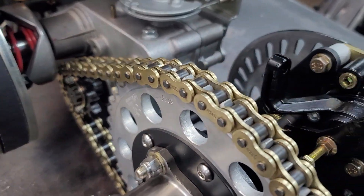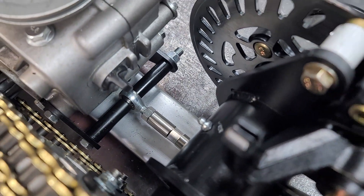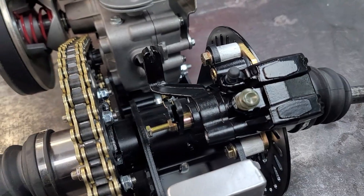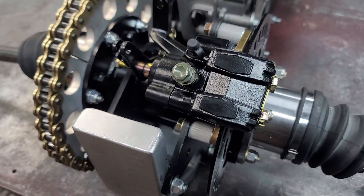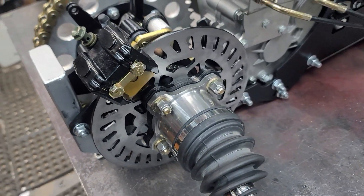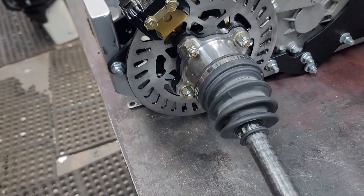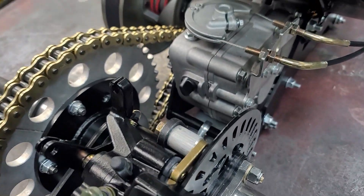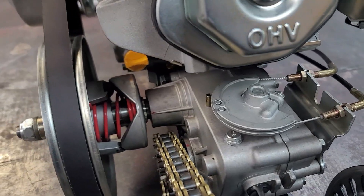It's got a tensioner mechanism with a grease fitting so you can lubricate it. It's got a parking brake provision built into a hydraulic single-piston brake caliper sourced from Yamaha Banshees, available aftermarket. There's a pit bike rotor, 220 millimeter diameter, which happens to have the same bolt pattern as the Mazda Miata axle, so it's all sandwiched together in there.